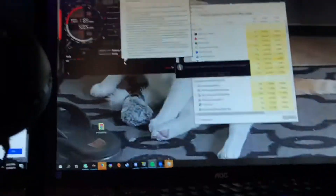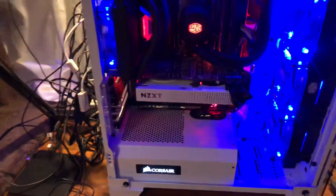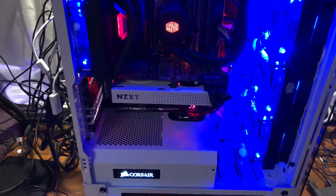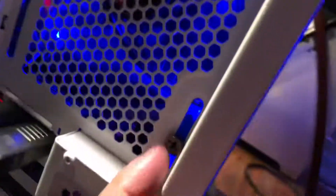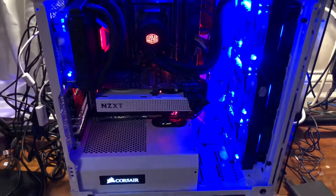It's in, it's on, and it posted — so that's good. Right now our GPU temperature is at 24C, the coldest I've ever seen it. I don't have my fan adapter yet, so I actually don't have anything plugged into the VRM fan, so I really don't want to stress it too much until I've got that sorted. But it's in — that's how you water cool a GPU for like $62 bucks. Closer to $70 if you count the fan adapter. You will need a couple of long screws to mount your AIO through your existing fan probably — there are ways of doing it without, but it's trickier. Sure fits the case a lot better than the nasty looking blower card.